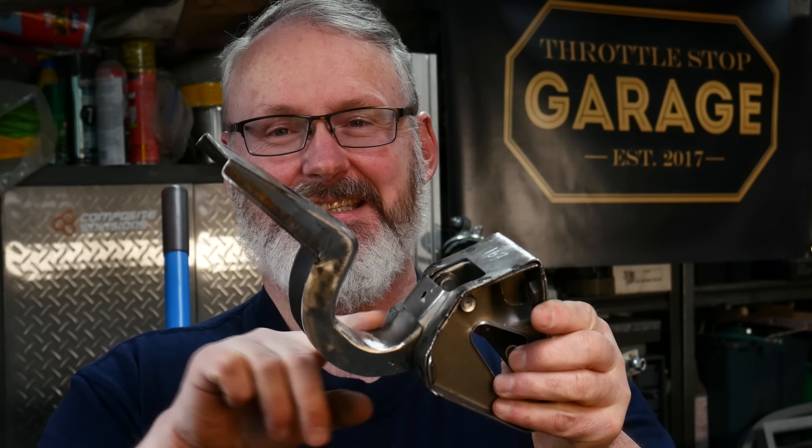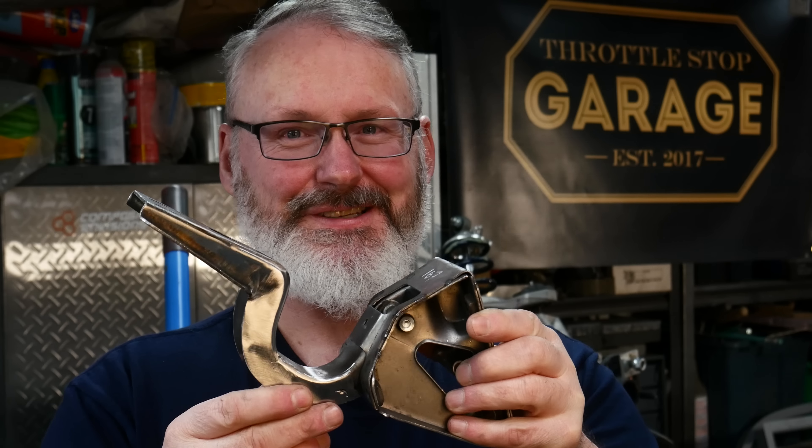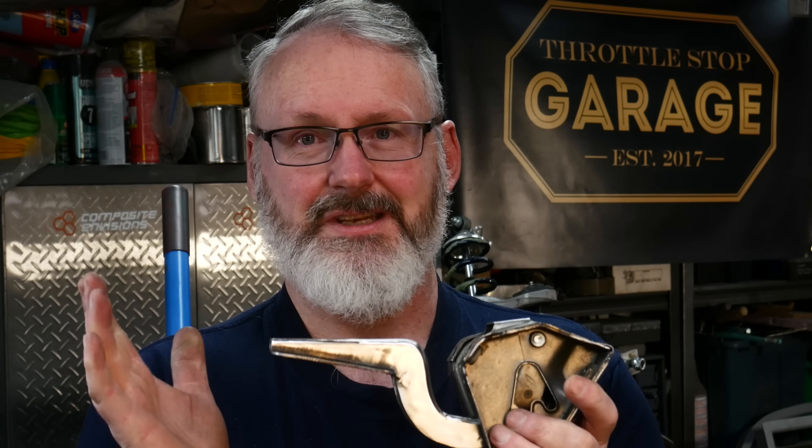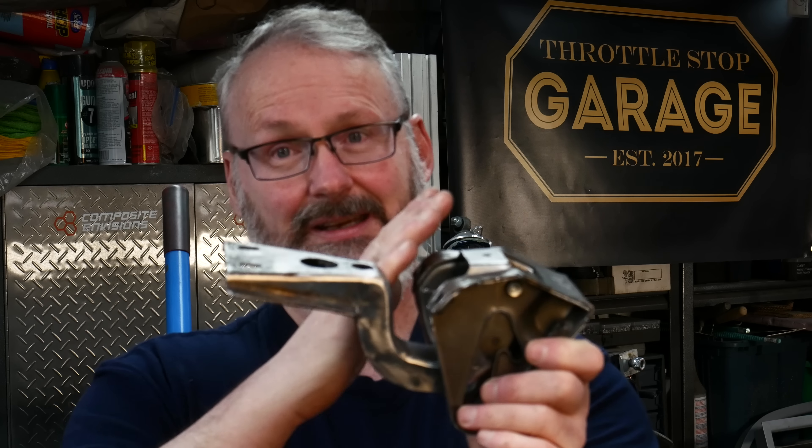Well, if you stuck it out all the way to the end, congratulations — that's awesome, glad that you're still here. There's the finished hinge. Who's ever going to know that these have been changed? No one's ever going to know that these hinges have been changed out and heavily modified. These work now. I've sided them and you saw me stamp the metal — that's the driver side hinge, there's the passenger side hinge. The carbon fiber part is not absolutely perfect side to side, but the holes ended up in slightly different locations to allow me to adjust the trunk lid still. They've turned out pretty well. It's been a month — I chased my tail on this forever. When the parts you get from the aftermarket vary by wild amounts — they weren't close, they look right, but they would never open a trunk lid — that is a consistent frustration. We fixed it, showing you one method: the cut and chop method with a little bit of thought. I always think it's going to be easier than it is. Thanks for coming along for the ride.